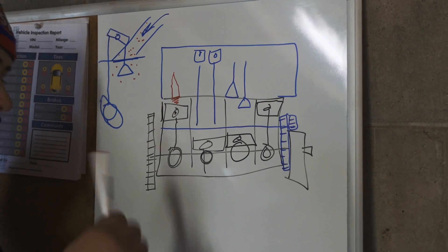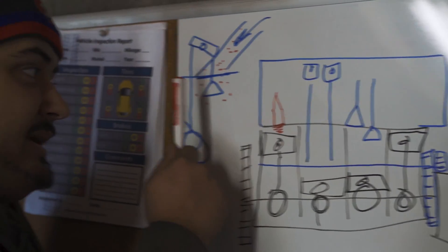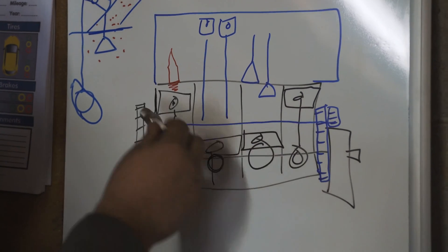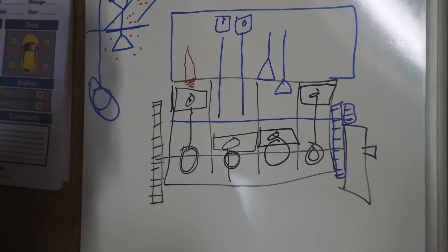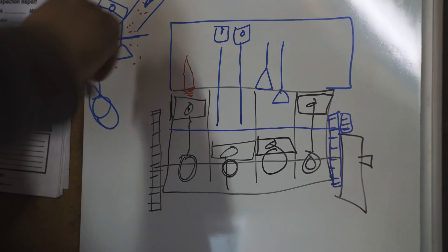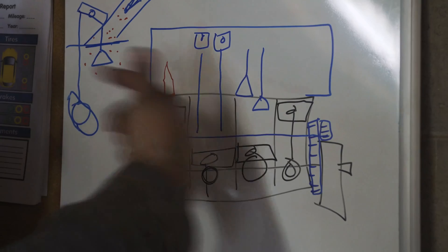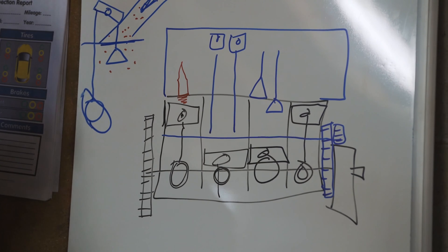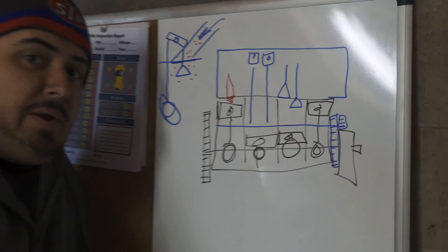Now the compression — which is our C before the T — is once the fuel and air get inside, this valve has to shut back tight so the gas and air are inside the combustion chamber so they can be blown up by our final spark. They have to be squeezed really tight by the piston coming up, compressing them all together where it's really hot, then the spark plug in the top of the engine arcs across the gap, and that electrical arc lights the gasoline on fire and it explodes. When that happens the piston shoots down and starts the rotation of the engine process. So if an engine doesn't run, you've lost one of these things — that is how all of the timing and compression works.